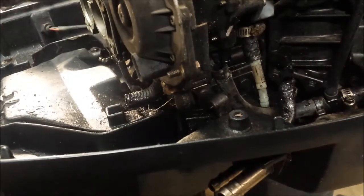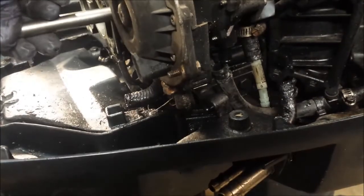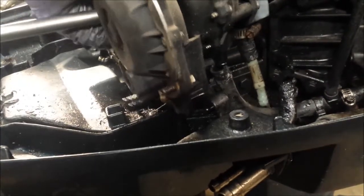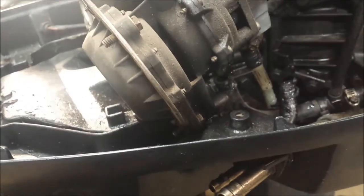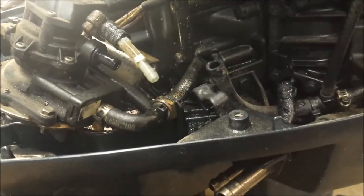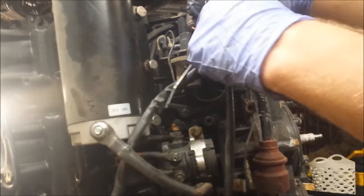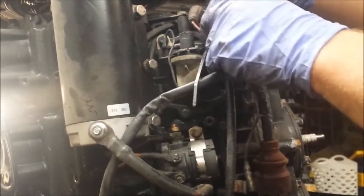Although, even a customer's, you just replace the fuel lines. Chances are it needed to happen anyway. Fitting down there — as you can see, that's really well attached. Now there's another connector right here — that's for the VRO. Slug that guy off. I like to put the clips back on the plugs so it's fine where they go, and it comes right off. What I do is I rotate and as I pull, it comes right apart.